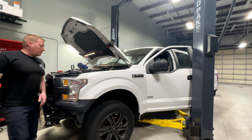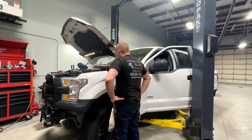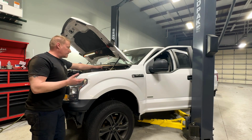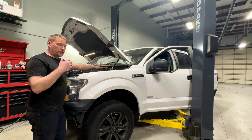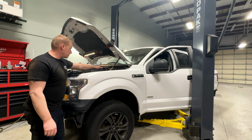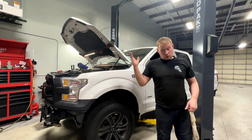A little louder on this side from the fuel pump, high pressure fuel pump. Everything sounds good. I mean, there initially we had the cranking issue, but then we also had the issue with the fuel system. Everything's new. Low and high pressure are new, so it takes a while for the crank and prime and shoot to actually shoot fuel and start. So all that's totally to be expected except for the battery issue. Sounds good. Real good, actually.